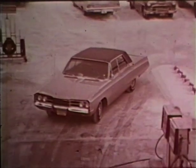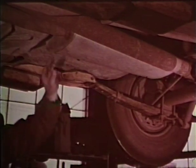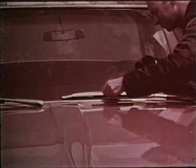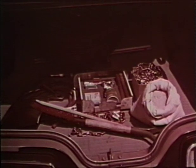Winter driving requires your car to be in first-class mechanical condition. The engine should be tuned for easy starts and dependable performance. The cooling system cleaned and antifreeze added. The exhaust system checked for leaks. Windshield wiper blades replaced if streaking. Heater and defroster adjusted for peak efficiency. Battery fully charged. And special emergency equipment ready in the trunk — sand or traction mats.